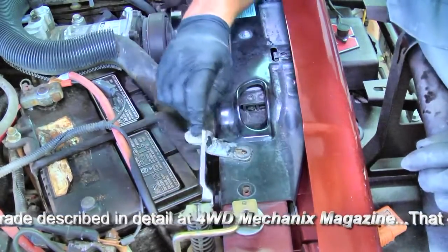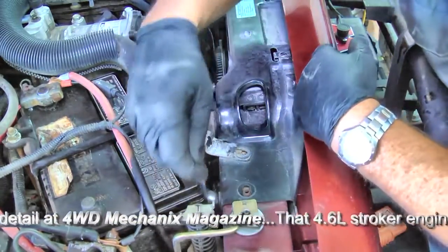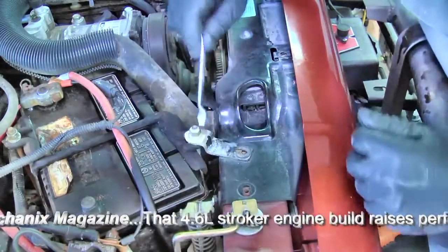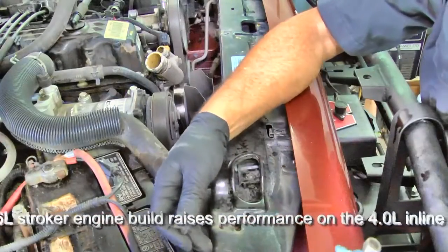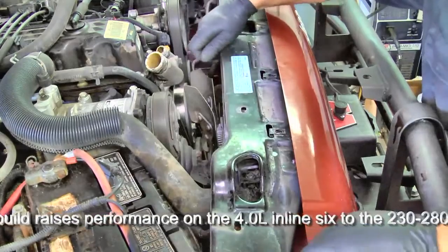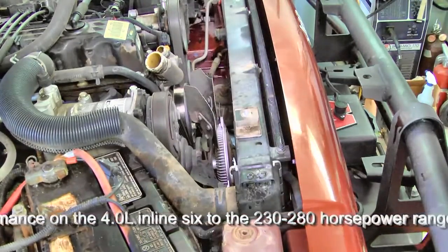There's no way to get an air ratchet or air gun in there — it's pretty close to the battery box. We should be able to get it out without removing the battery. We'll loosen the battery hold downs and slide the battery out of position slightly. With the last screw out of place and the battery moved to the side just slightly, you can lift this piece out — and that crossmember is your upper support for the radiator.